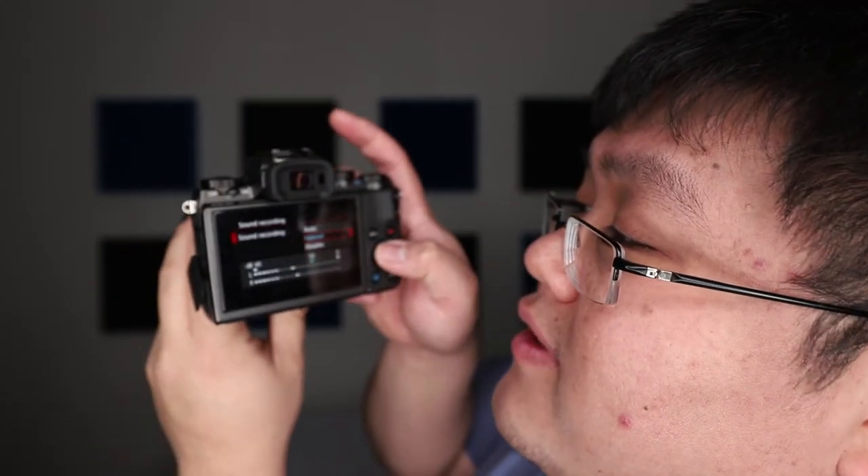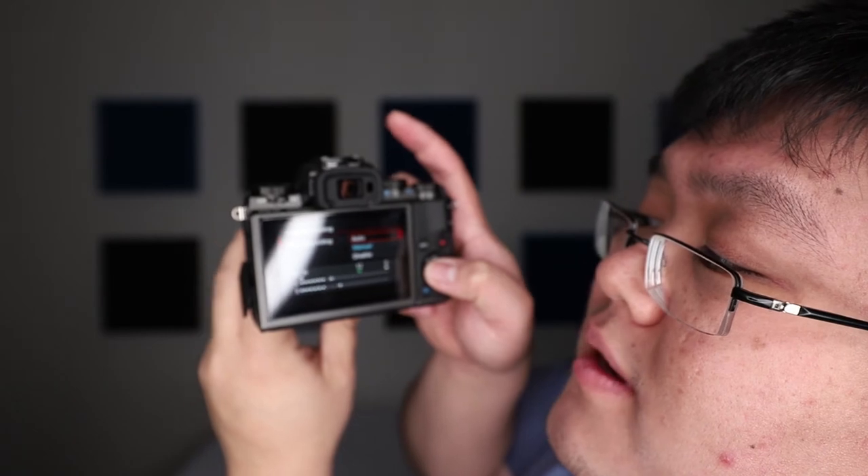One more thing — make sure to put the recording setting back to automatic. If you leave it on manual with your external mic settings, the audio from the internal mics is going to be really low, and you'll be hurting in post because you'll have to boost it so high that you'll boost noise and hiss with it. So set it back to automatic. Here's what the internal M5 audio sounds like — don't forget to change it back to automatic.